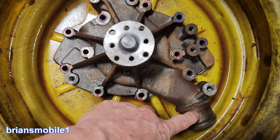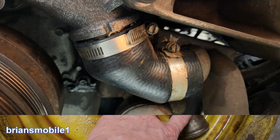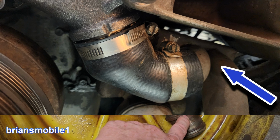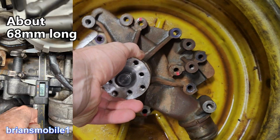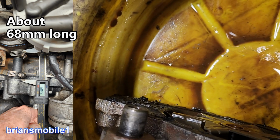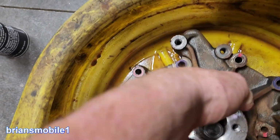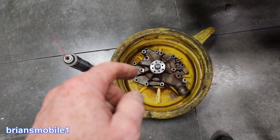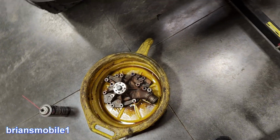Again, you want to put on the bypass hose, that output hose that goes to the oil cooler, on here first. And you want to also have on the other side a 5/8 inch piece of hose, and you want to measure that ahead of time. There's no nipple on this one, so I seal them on. I have everything really clean, and I put a little Permatex Right Stuff on those nipples. Don't put it in the hose, put it on the nipples, and that way it won't plug up the hose.